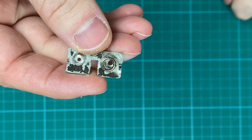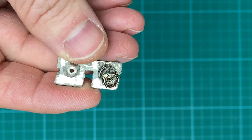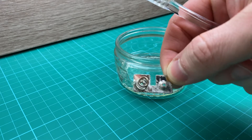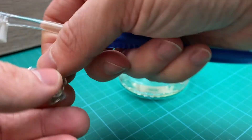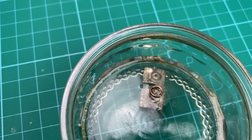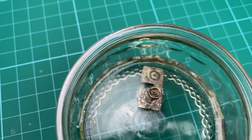Can it be removed? Well, if you're using an alkaline battery, the residue it leaves behind is an alkali, so it's best to neutralise it with an acid. Neutralising it like this can cause an exothermic reaction, which releases heat — and this can also be damaging. So it's best to remove as much of the loose residue as possible first. Then, if you can take it apart, soak the affected pieces in an acid. Probably the easiest acid you can use, that may already be in your home, is vinegar — preferably distilled or white vinegar, as it leaves things less malty.